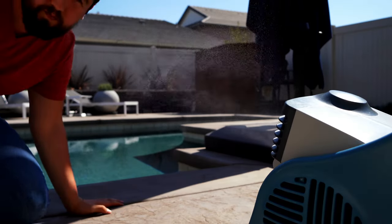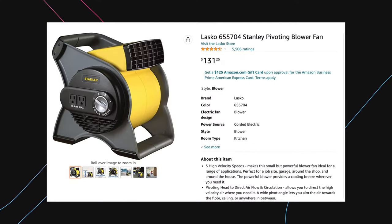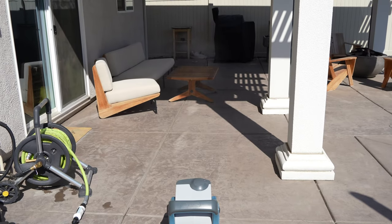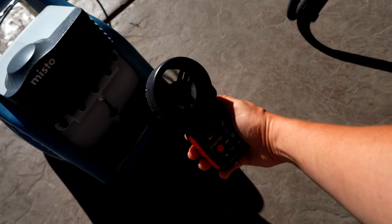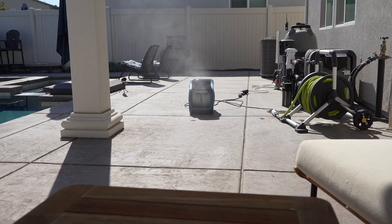And without any mist at all, life is just miserable. Number three: fan power. It's absurdly powerful for its little size. The volume is only 350 CFM — not much — but it's 50 more CFM than the super popular Lasko Stanley blower. There's a reason these types of fans are popular in construction — it's not because they're cute, which they are. It shoots a powerful cylinder of air. I clocked it at 20 miles per hour. That's great for ventilation or propelling mist like a cannon — we're talking up to 20 feet. I found it ideal at about 10 to 15 feet. I give this tiny fan a fan power score of 9.1 out of 10.